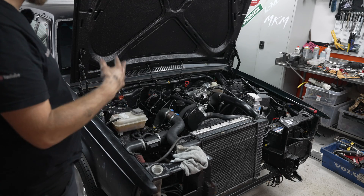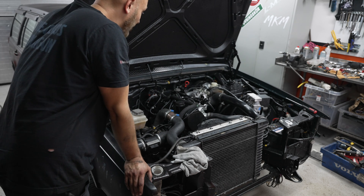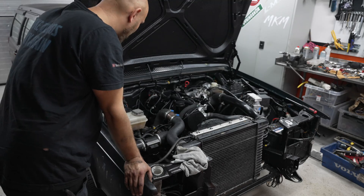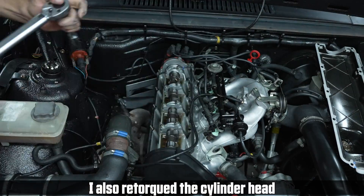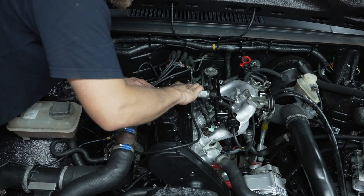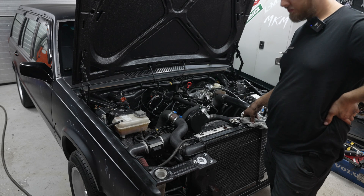What I'm going to do is drain the oil while it's hot, take that oil filter off, throw that away, put another oil filter on, fill it up with oil again. Then we're going to run the car for maybe a day or two, and then we're going to exchange the oil again and put the real oil in there. All right, well, that's it — see you guys later.